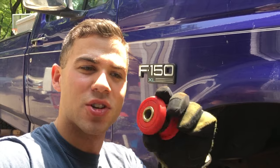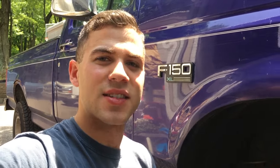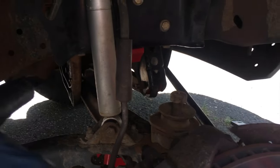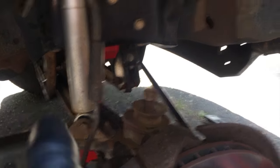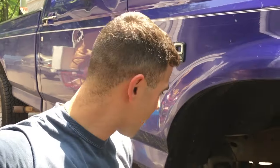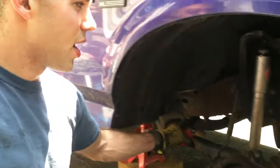One thing with these old Fords is things wear out — that's with any car. A particular part that wears out is the axle pivot bushing. After '96, Ford went away from what is known as a twin I-beam suspension, which kind of looks like scissors. There's a beam coming this way and one going there — bolted on opposite sides, a cantilever-type early independent suspension. It bolts at the radius arm and at your axle pivot, so those points take a lot of wear.